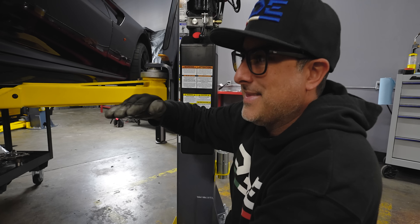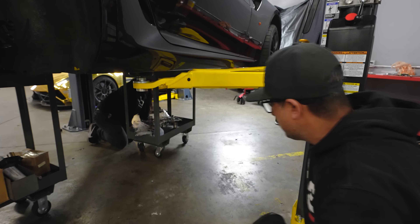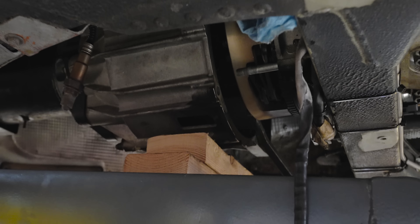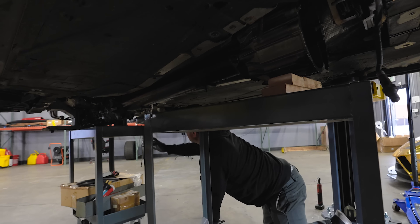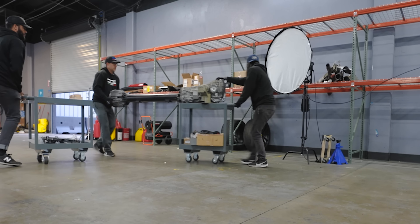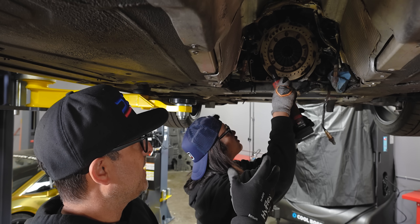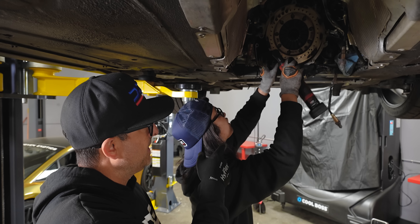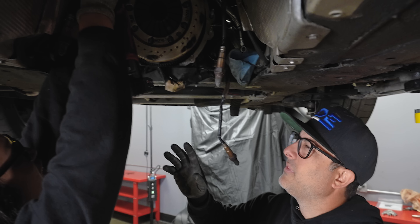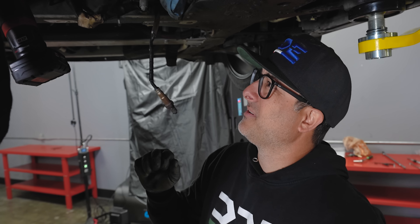Slowly raising the car now — we can only go up a little bit and then we have to get the bell housing off because it's basically running from the front of the car to the back with the torque tube and bell housing. It's starting to separate. It should pop out and drop down off the wood support. It's out. Now that we've got the transmission and torque tube bell housing out of the way, we're going to pull the pressure plate off, and then we'll be able to see the clutch disc underneath.